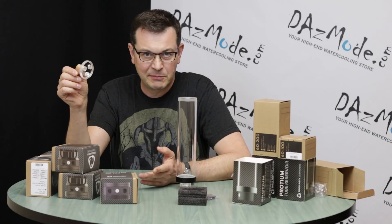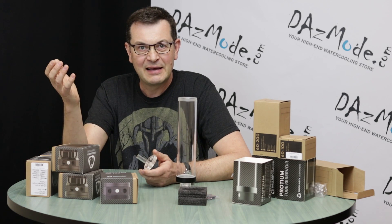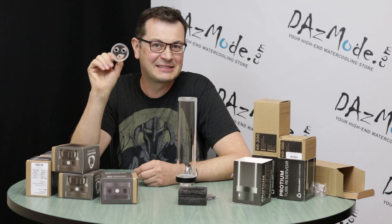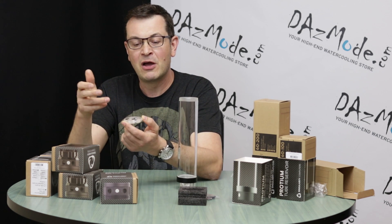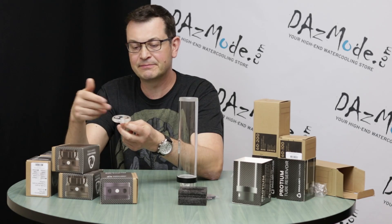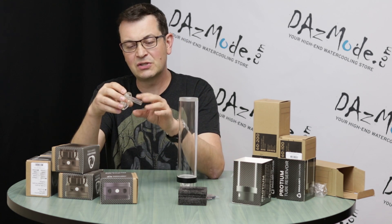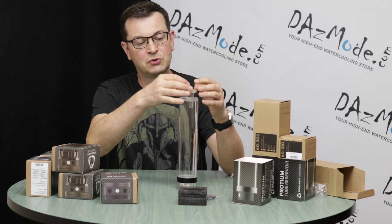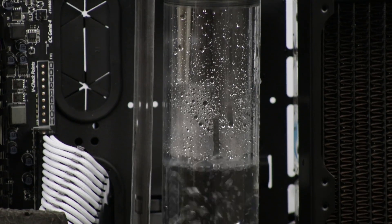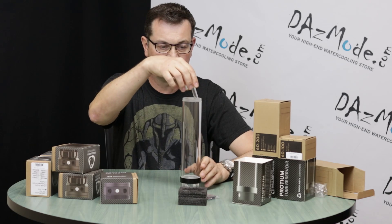The top — unlike Bitspower who likes to give you a single port so everybody always has to buy additional replacement tops to get two or three ports — Daniel is not stupid. He makes three ports right away, so you have the opportunity to have not only the inlet for your reservoir but also your filling port as well. We have this little piece of tube that helps you avoid additional bubbles — if you put liquid above the level of the tube and this is your inlet, the water will not hit the surface and won't create additional bubbles. It's a pretty standard feature and it's present here.